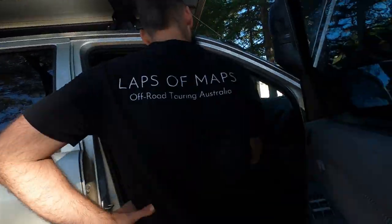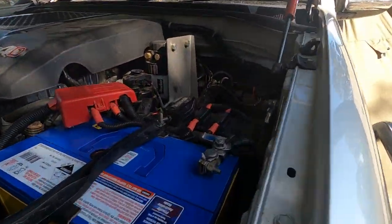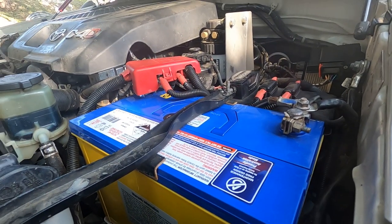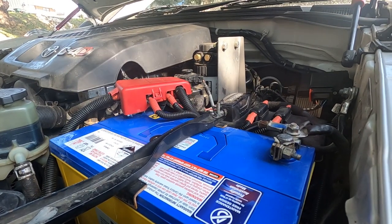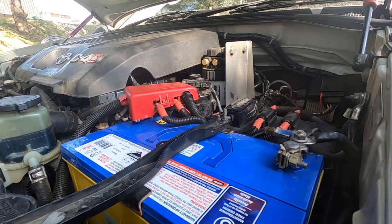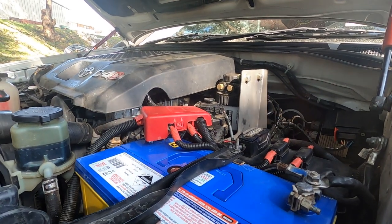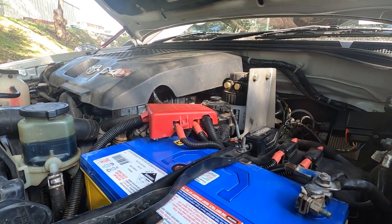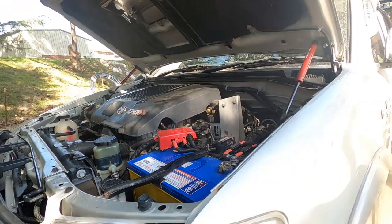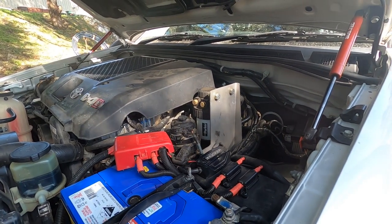What day is it today? Thursday. Yesterday we did the alternator. We packed up and hit the supercars in the distance. So we put this new battery in, checked the volts, and it went from 13.3 while it was running down to 12.8 then down to 11.5, so we knew there was an issue straight away. We disconnected the charger wire and it was sitting at 13.3 — it should sit around 14 volts. We came to the conclusion that our alternator is just struggling to keep up with the amount of electrics we have on here. So we went to Repco at Bathurst and they dropped $200 off the alternator for us and whacked in a 130 amp. Now it's working normal.